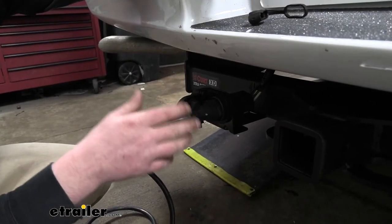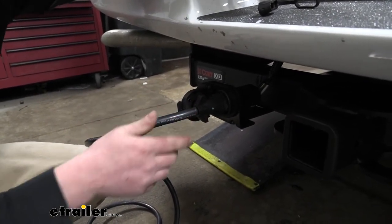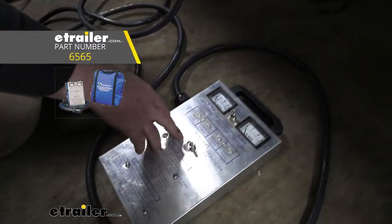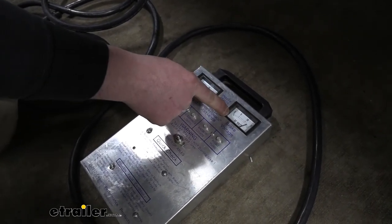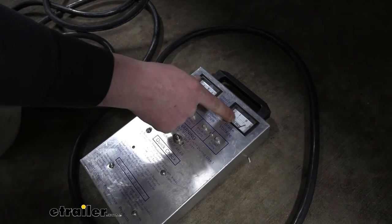Once we have our seven-way in position, we can go back and tidy up our install. I taped up all of our connection points with some electrical tape, then used a couple of zip ties to secure our new trailer wiring to some of the existing factory wiring along the way — just ran it along through here, brought it up, and dropped it down to our plug. Now that we have everything hooked up, it's a good idea to test it to make sure it's working properly. I just plugged in a tester box — if you don't have one, you can always just use your trailer. First thing we'll do is see if we have our 12-volt power, which we are getting as the DC voltage is indicating.